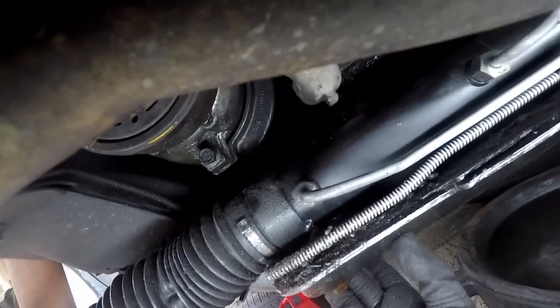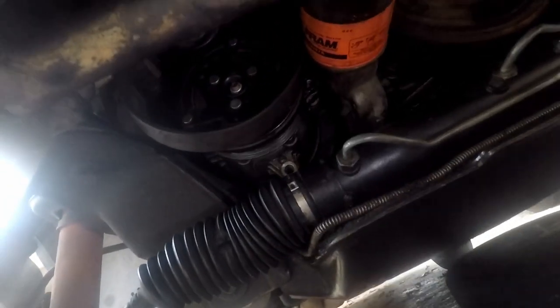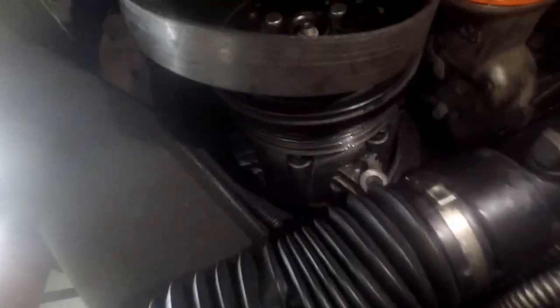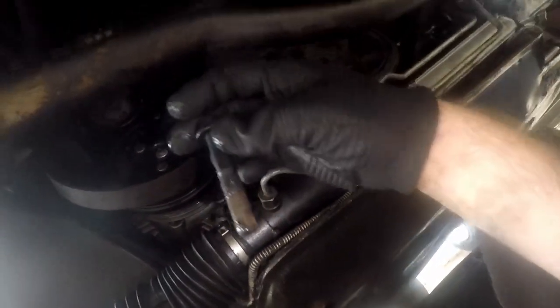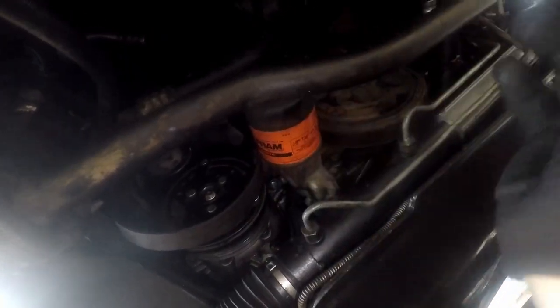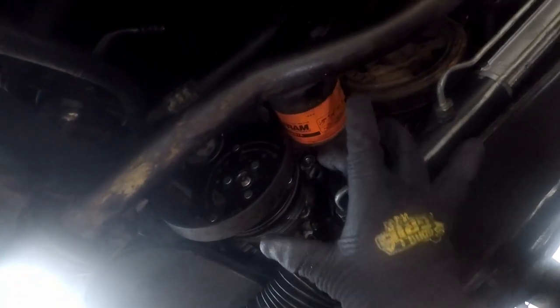However, the passenger side bolt — you can see the head sticking up there — is hitting my AC compressor when I lift it up. I managed to get the passenger side bolt out. Instead of cutting it, I spent a couple extra minutes taking out the bracket for the AC compressor — not necessarily taking it out completely, just loosening it up. All the bolts are out for the bracket and I'll post a diagram in the description once I found that, which really helped me figure out where to look. Compressor moves, bracket's loose, and I was able to pull the bolt out directly from the top. I don't know why I never saw any mention about the passenger side not fitting with the AC compressor — maybe because most people don't have an AC compressor anymore, or maybe it's just a V6 thing.